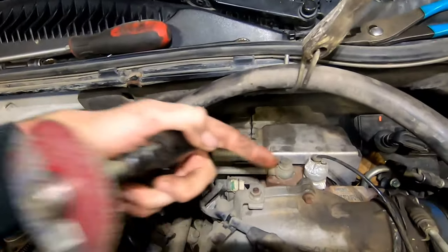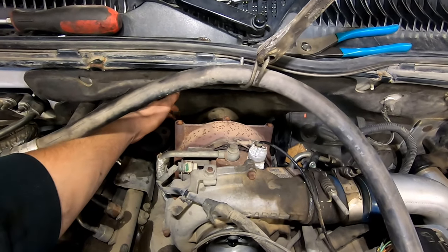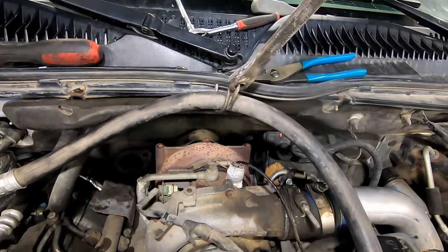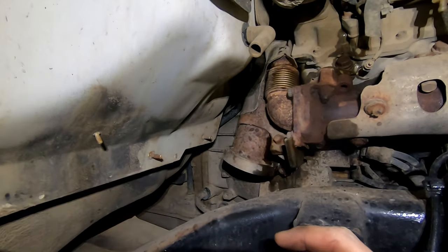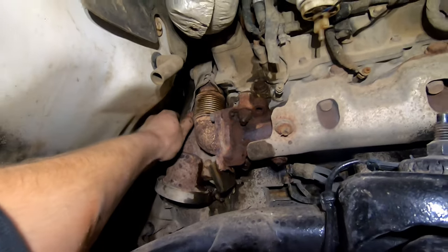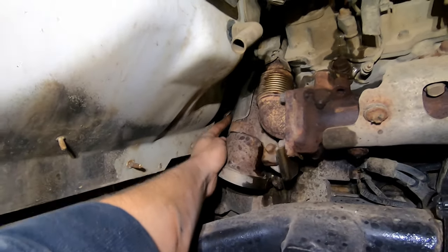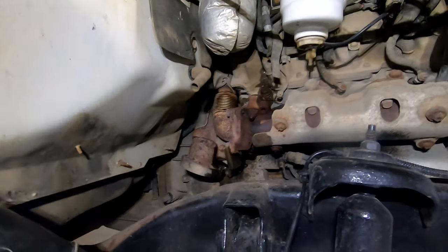I cut it, got the heat shield off, and now there's a heat shield on the actual back of the downpipe with three more 10mm bolts. I'm going to try to slide that heat shield up and take the downpipe out through the bottom. I pulled the wheel off and got the fender out for more room. The exhaust on this truck was a dual system that was falling apart, so I've got a new single system going on. There are two bell housing bolts with nuts that you've got to loosen to move the tranny dipstick up out of the way.